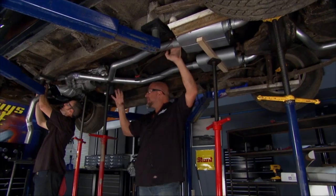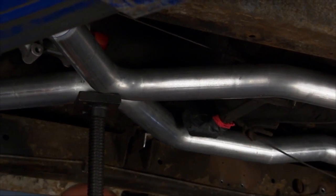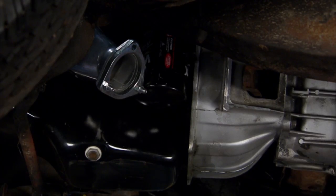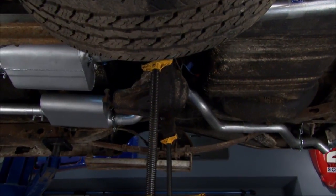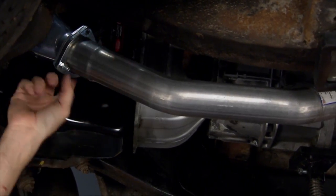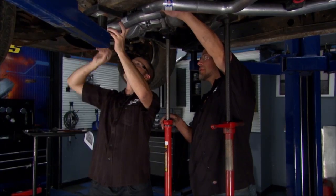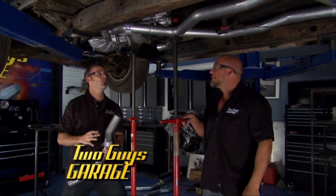Still at our exhaust, making sure all the fit and finish on it is great. The computer-controlled mandrel bending makes it really nice — guaranteed good flow. Any time you add headers, that's a modification, but they give us a little bit of wiggle room, which really helps. No header manufacturer from one to the other is going to give you the same pierce point or the same angle. So what you want to do is get your full setup all the way back, everything mounted nice, and then you take the last piece, mark off one or both ends, take a little sliver off. I'll make a nice clean bandsaw cut, get this fit up real quick, and when we come back we'll get this guy welded and bolted in solid.